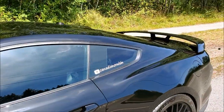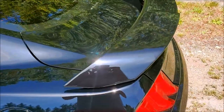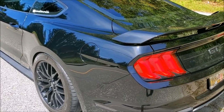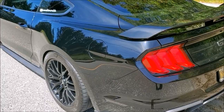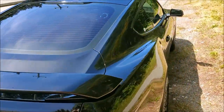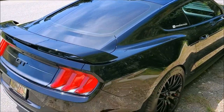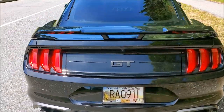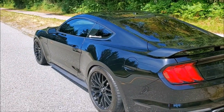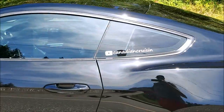She is done, she is dry, out in the sun — all shiny, good to go, good as new for the most part. Still a couple little streaks and a couple rock chips, but it's my first time doing it and I'm not in a big huff over it. Super easy to put on. A couple tips: make sure you're wearing shorts or something with no zippers or buttons — you don't want to scratch it as you go. And when it comes to buffing it off, if it looks like it's smearing, it's either not dried long enough or you put way too much on. Just give it a couple minutes, give it a good wipe down, it'll come off and you'll get this as your result.